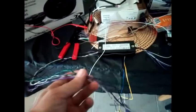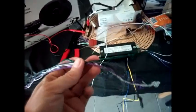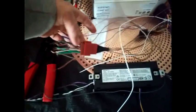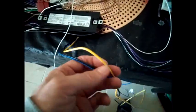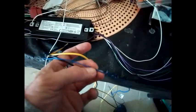This will be the input to the amplifier — I'm using the high-level input. It's a bit less cabling and the signal shouldn't pick up as much noise from the car. This will be the output cabling. I'll be using a spare ISO harness I had left over — one side will go to one end of the cabling and the other side to the other end. All I need to do is separate the cabling running from the head unit, plug one in here, plug one in here, and pop a bullet connector on the end since the Sony harness has a spare connector.